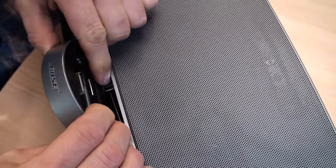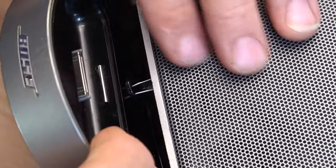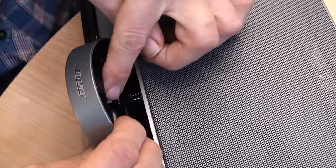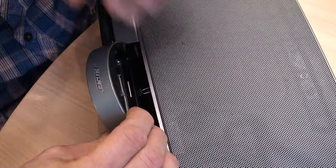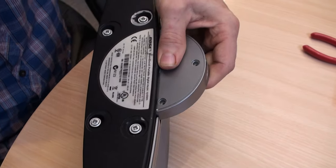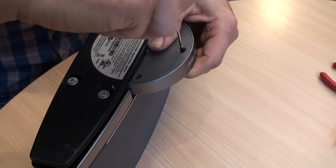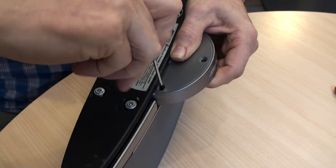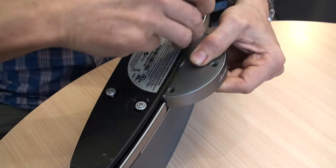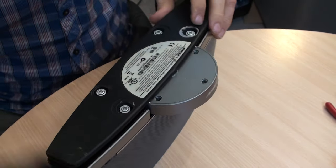Be careful not to pull the ribbon cables out too far — they are quite long inside the dock and there's a rubber seal, so it's not easy to push them back. If you need instructions on fitting the board from start to finish there is a separate video on our website covering fitting the connector — this video is specifically for the rear IO board. Put your three small screws back in and nip them up — not too tight, but they'll suddenly feel tight when you've reached the end of the thread. Then tighten the four base screws up fully.